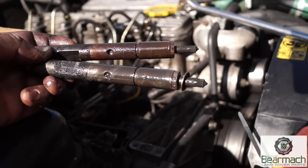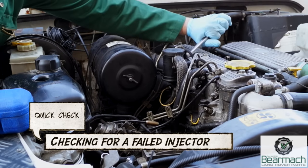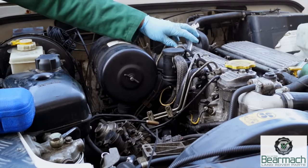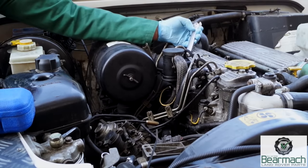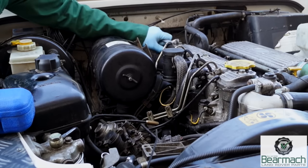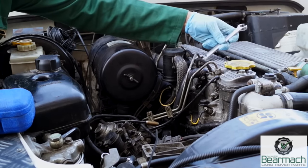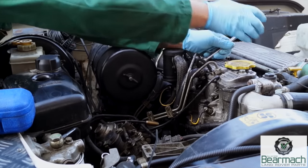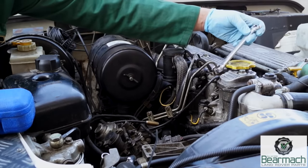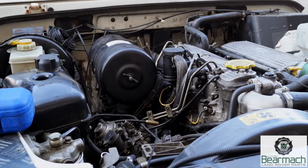One of the things to get through in this video is changing injectors and checking for faulty injectors. Diesel engines like this with a rotary pump do not have injector compensation. So basically when you crack off an injector — so the pressure is off of the injector — the engine will run lumpy. If you have an injector that is faulty and not injecting, it will stay the same or the pitch of the engine will not change. However, every single one of these injectors on the engine — all four of them — are injecting. This is a basic check if you have an engine that is running lumpy.